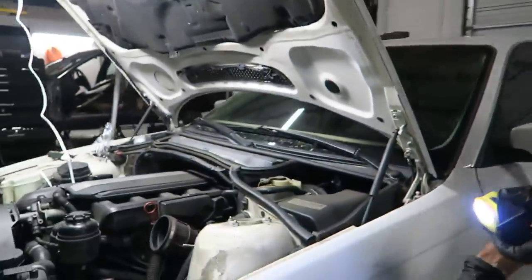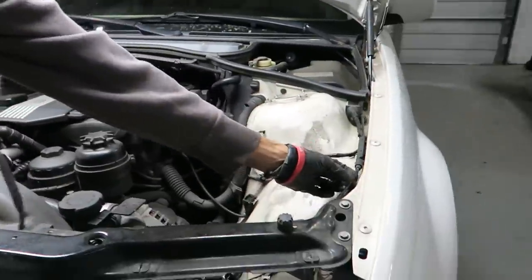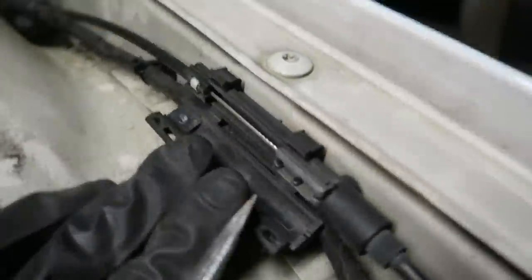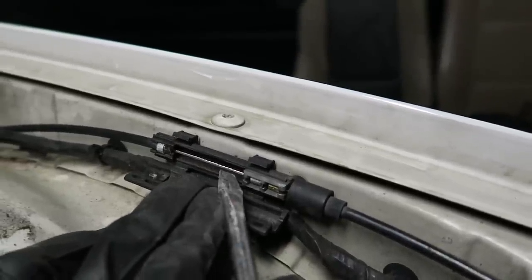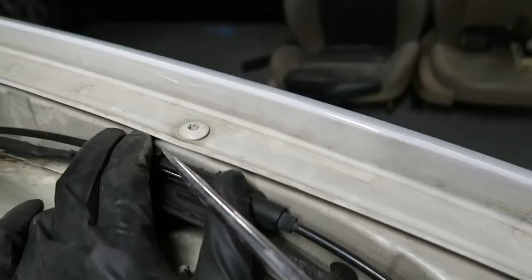If you have fender liners — they usually break, but if you do — they line the whole section from here and attach to the bumper. Go ahead and remove both fender liners and all the under-car covers attached directly to the bumper. One more thing you'll need to disconnect is the wire that goes to the hood latch — on all E46s it's hooked up right here. Be careful not to scratch your fender. It just pops off like that. Inside, one wire goes to the cabin and the other goes to the hood latch. I always pop off the wire going to the cabin and pop this whole unit off from the fender support.